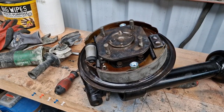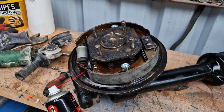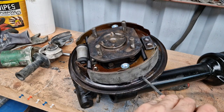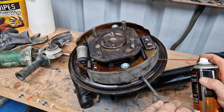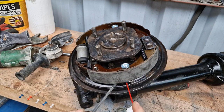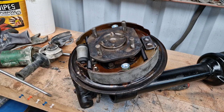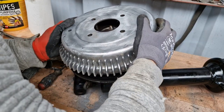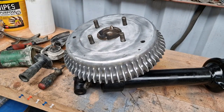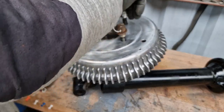I've gone and gotten some Trefoil anti-seize copper grease, and I'm going to use this at the key contact points in the back of the drum, using it sparingly. Before you spray the stuff, it's best to pump a little bit out first because it initially comes out with just the solvent. Next, stick it on the hub — yeah, I like it, beautiful. Let's go put these on — 95% of this will be in behind the wheel so you're not too worried about anything visible in here.